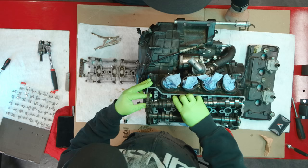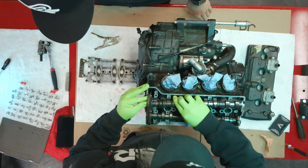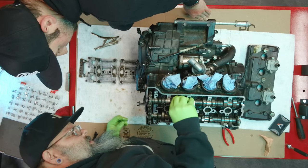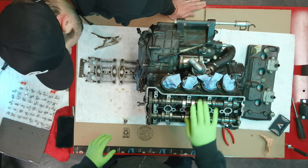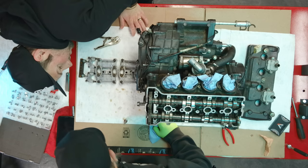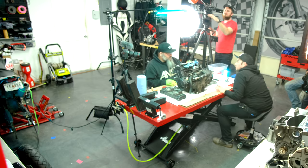This in here like so, get on the chain. That might be it, or is that it? I think that is as close as we're gonna get it. Okay, so that looks good. So you got it in flat, double check flat. Here, make sure that nothing's moved. You have the line to the right of T touching the little notch. And that's where it needs to be.